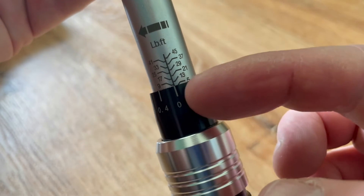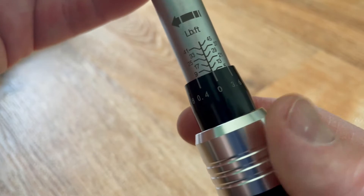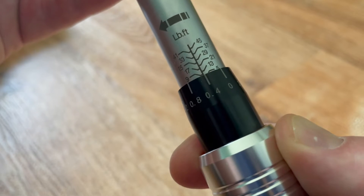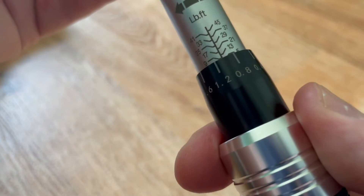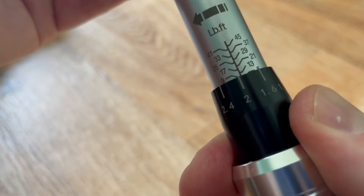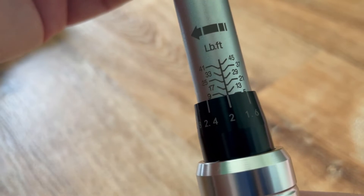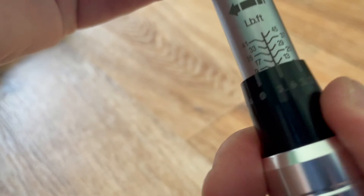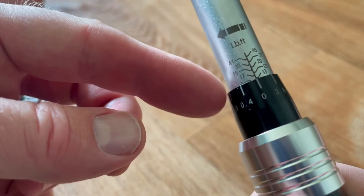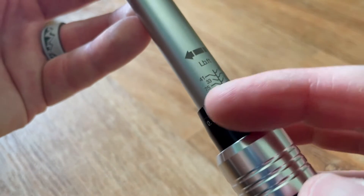The five is the readable number and the actual measurement goes down just a little bit. If I want increments, I pull this down and as I swing over, I've just added nearly half a pound. If I continue up, you can see it's at 0.8, 1.2 pounds, and it continues up all the way around. If I lock it in place on the two, we're now at seven pounds. If I go all the way around, it's going to dial in to nine pounds. That's basically how you increase or decrease based off of these specific digits on the dial.